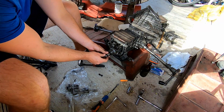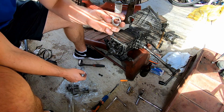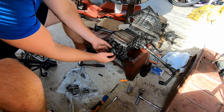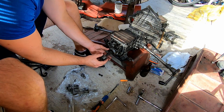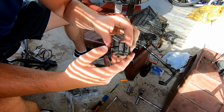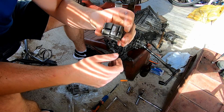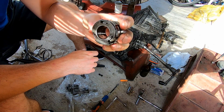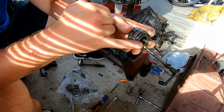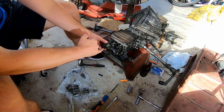To start off, I'm going to take off this nut and washer - this is the speedometer drive gear, or odometer drive gear. Be careful with this because inside, this piece, this piece, and this piece are all held on with that little band going around it. If you do happen to drop one, that's how it goes back together: these little tabs going out this way, the whole assembly going that direction with the tabs this way.